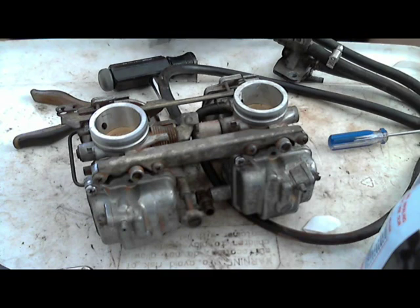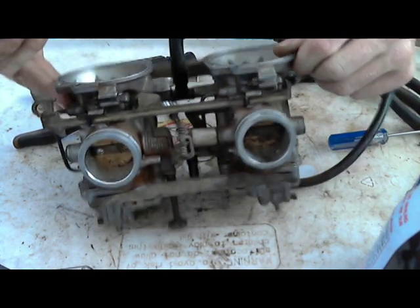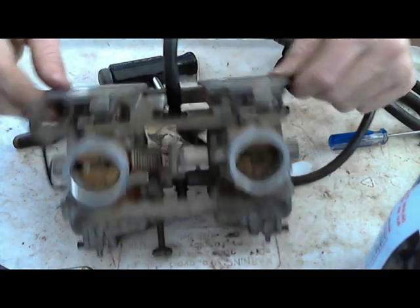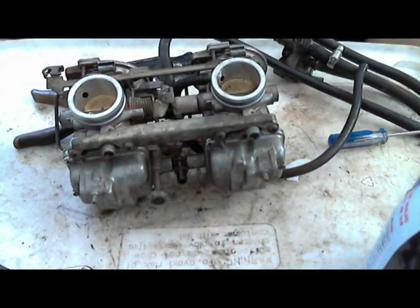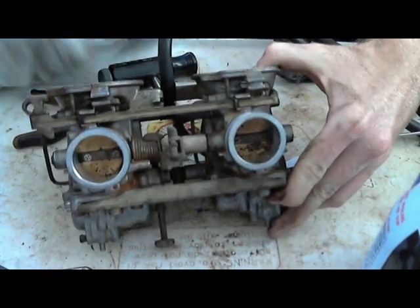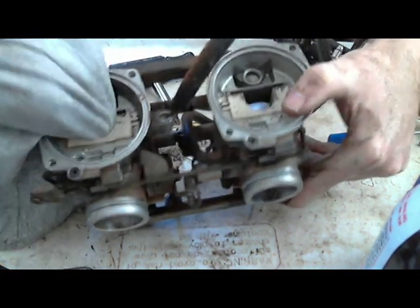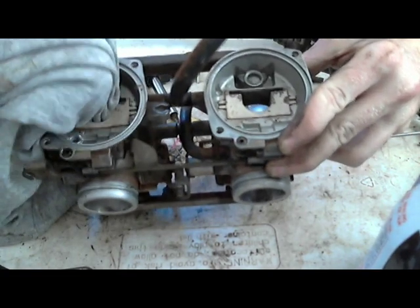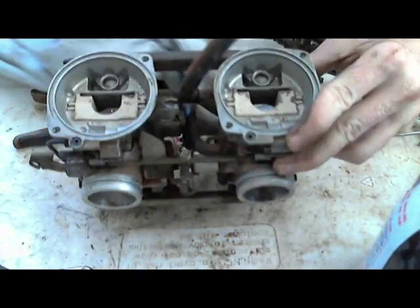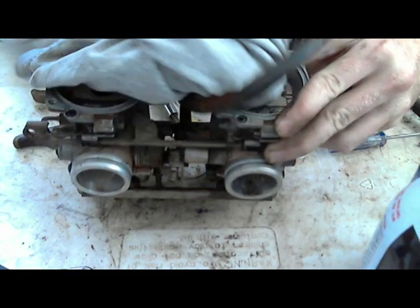After this is clean, you put them back in, and that's it. Oh, I usually do this too, I just forgot. It's not just cleaning the diaphragms; if they're dirty, you'll also want to clean inside these grooves. I can turn this so it's facing the camera. I'm just cleaning inside of here as best I can, so that it slides freely like it's supposed to.